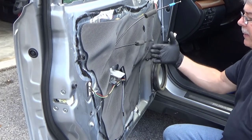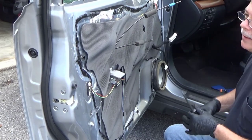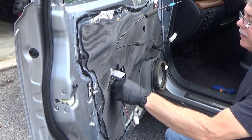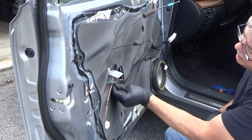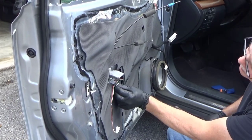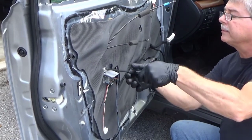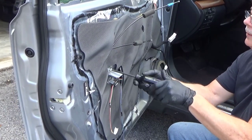Since we're going to have to pull this plastic off and around all these wires, you'll need to disconnect the speaker wire, and you'll need to disconnect this wire set right here. And it's just squeeze and pull. Now this has actually got a little catch in it, so I'll probably get some pliers to squeeze it and push it through. This bracket will have to come off. It's 2 screws because it's actually got the plastic. It goes over top the plastic, pinching it down.